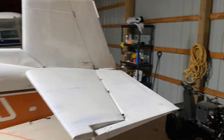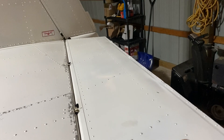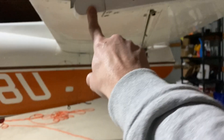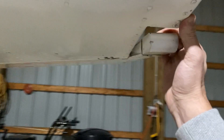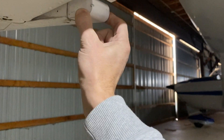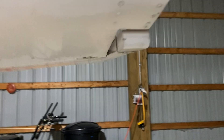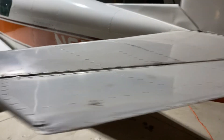Smooth skin — you can see the smooth skin elevator. The ones not affected by the service bulletin have ribs up and down them, so we're definitely affected in that way. Here's the weight. If they're not two parts — if they don't have a hole drilled through them — then you're good. On the left elevator, looks good. Just a solid steel weight.